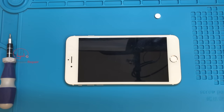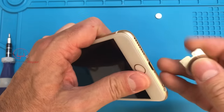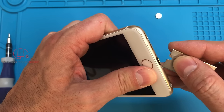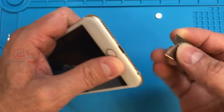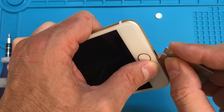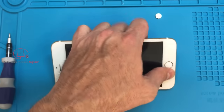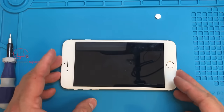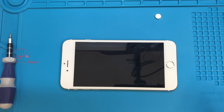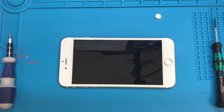I want to give you probably my last resort. You can try going in here with the corner of a razor blade and just kind of pry it out. But if you do that, be very careful because these can snap off and you don't want them to fly and hit you in the face — definitely wear some safety goggles if you're trying a prying technique. Outside of that, short of soldering the screwdriver onto the screw, the last option is to use crazy glue. Right now I'm going to show you a clip from when I actually had to do that.